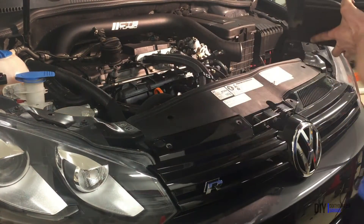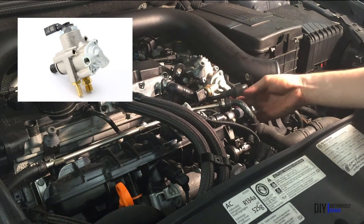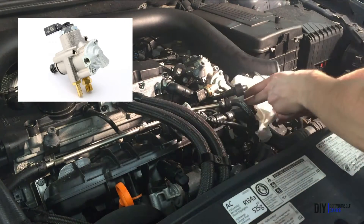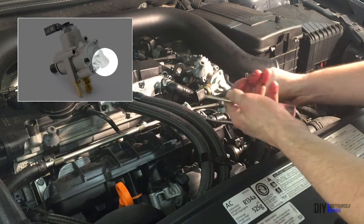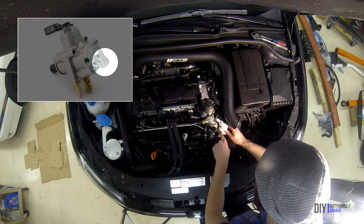This gave me enough room to work with. So now onto the high pressure fuel pump. Be careful while performing this next step as the high pressure fuel pump is under high pressure. Remove the cap covering the bleeder valve, then place some paper towels or a rag under and around the bleeder valve. With a small screwdriver, push up on the bleeder valve to release the pressure. There will be a fair amount of fuel that comes out.